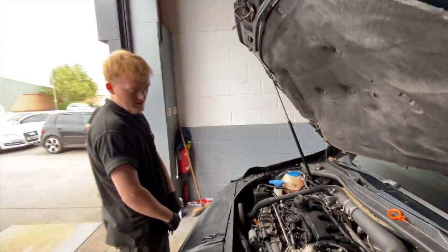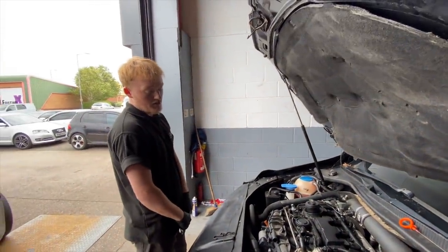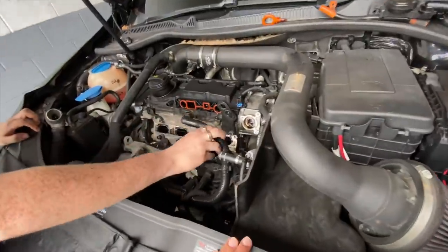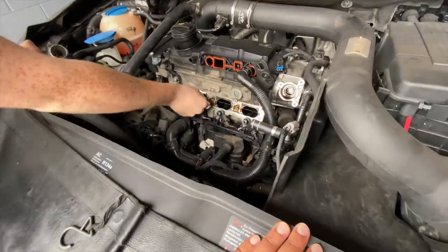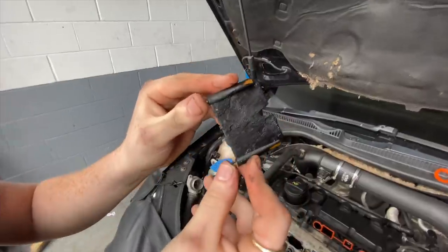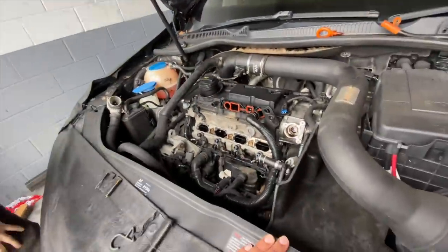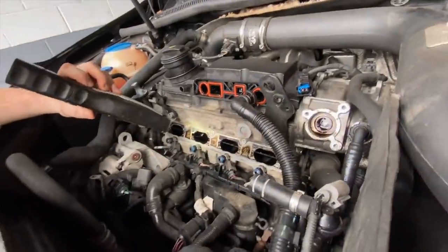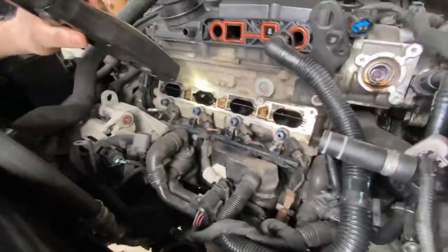So the plan right now, Alex, we're just taking off the inlet? Inlet, check your injectors and we'll clean this one as well. Sweet. First I've seen on the inside of this engine. What are we thinking so far? 129,000 miles of... That's quite mucky, doesn't it? Yeah. If you look in the inlet. So it's good to see it hasn't got a runner flap delete or anything like that, or they aren't just chilling in there. That's a good sign, yeah.